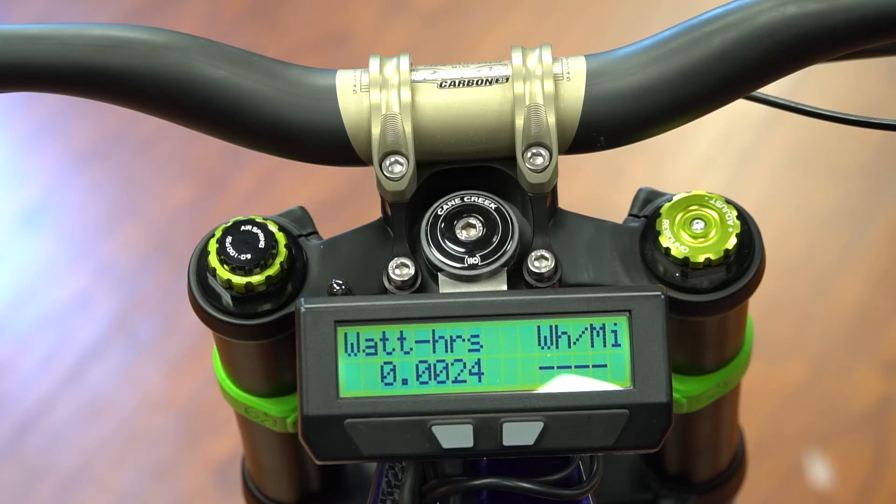So if you have a 640 watt hour battery system — you multiply your volts times your amp hours to get your watt hours, because that's the total stored energy in your battery — then you'll have about 32 miles of range. Divide the watt hours by 20 to get your range estimate. So 640 watt hours equates roughly to 32 miles.